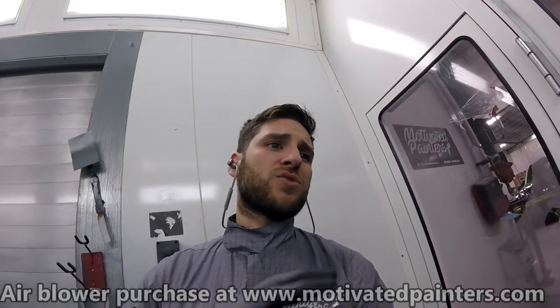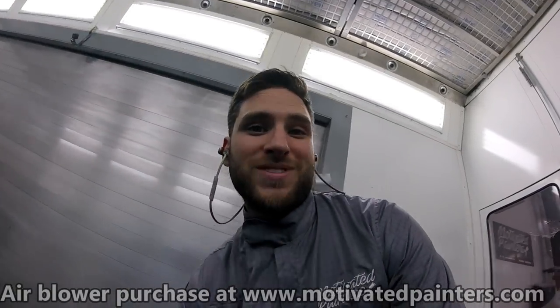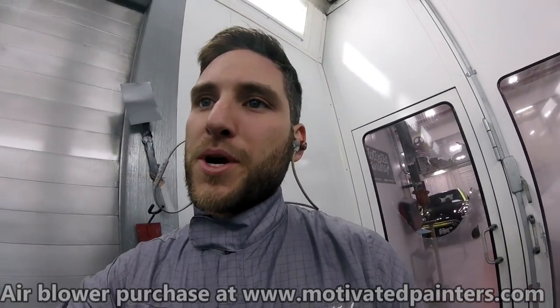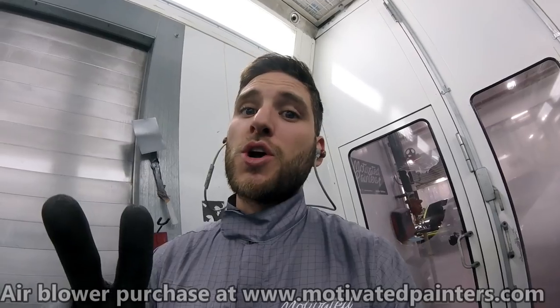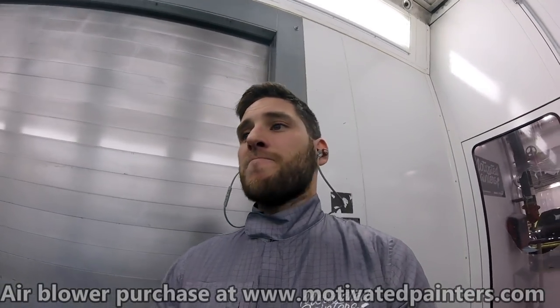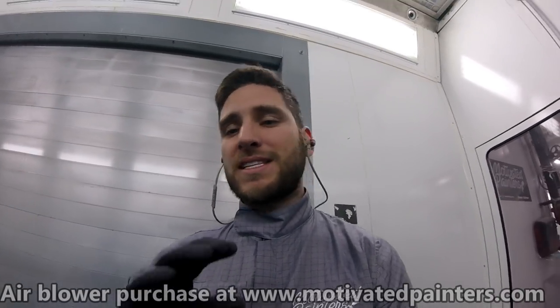But like I always tell you guys, don't do anything I say. I'm not a PPG rep, and I don't suggest you do anything that I do. And once you put on your first coat, you make sure that you let it flash off at least 15 minutes, all right? If it's still too shiny, you let it flash off 20 minutes. You gotta let it flash off, that's key.